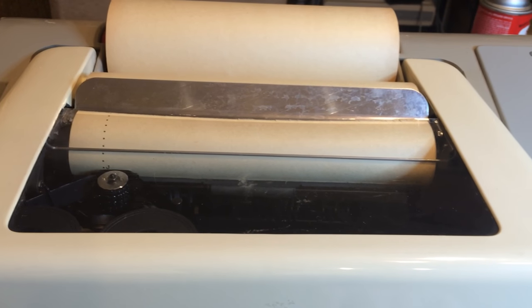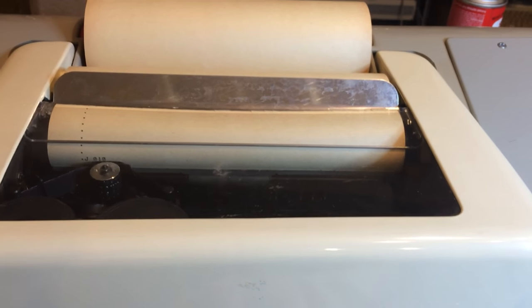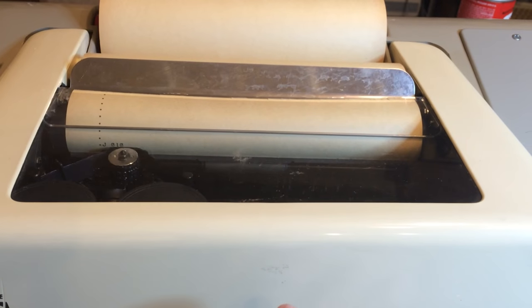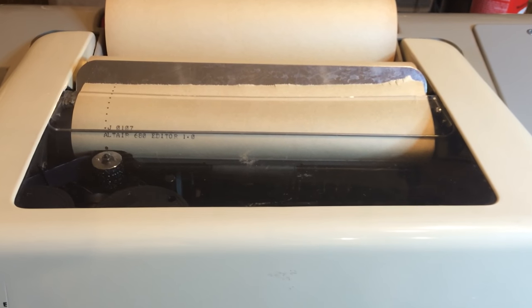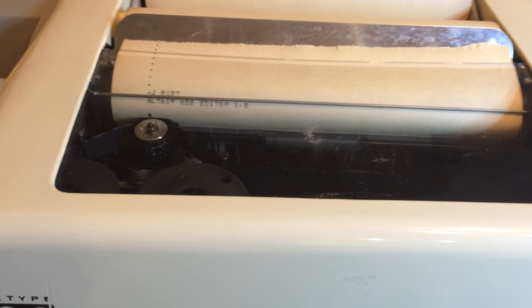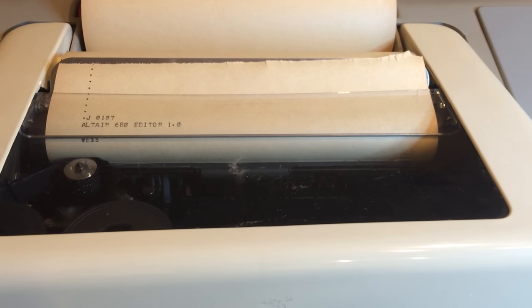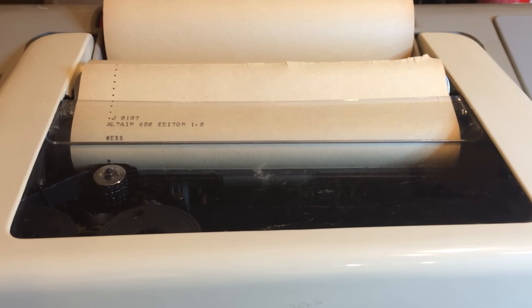So we will jump to its starting address, which is 010. You can either do 7 to clear the buffer or C to keep the buffer intact. There is nothing in the buffer, and I think if we tell it to retain the buffer without going through its clearing procedure, we might get a bunch of gibberish in the buffer. Here we are at the Altair 680 Editor. If I tell it I want to see everything that is in the buffer, it basically has nothing in the buffer.